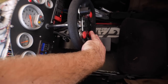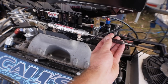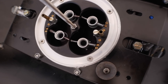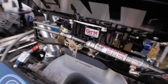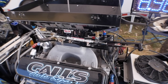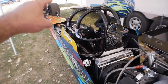As soon as you activate the ProStage by clicking the bump down button, it is going to exhaust the cylinder — this piston is going to be allowed to exit and basically go limp. When you push the throttle pedal down, the cylinder gets longer. You could hear it activate. It doesn't move without your foot on the gas, but with your foot on the gas it would pull the carburetor open just ever so slightly — maybe a couple hundred RPM or about a hundred RPM — and that is a consistent RPM you can then stage your car at.